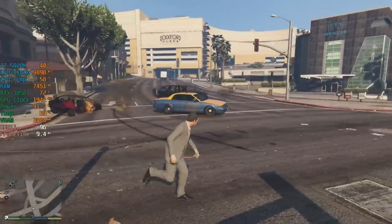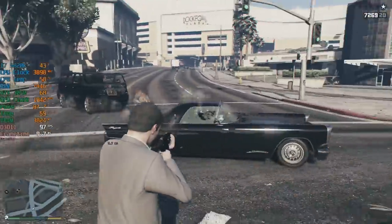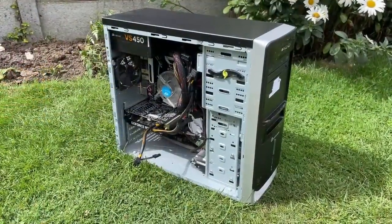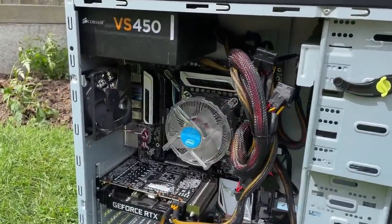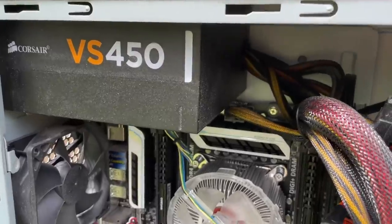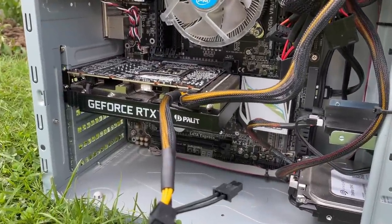The thing is though, because the 5820K is still somewhat capable, you can pair it with a modern entry level mid-range card, something like the 3050 or 6600. I wouldn't go much higher than that because the CPU will be a bottleneck, but you compare it with one of those and have a pretty decent experience.